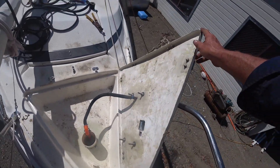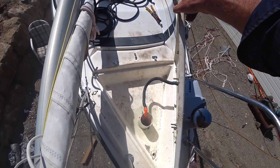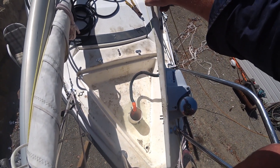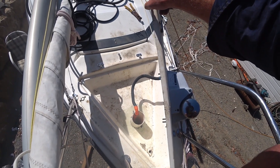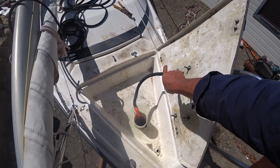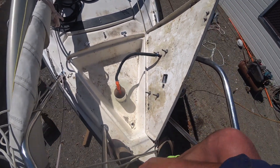And so when I close this one up, you can see there'll be a bow down. So any water that gets in there — like say when we're travelling along — with the bow in the cable there, it'll hit down. The water will go to the bottom of the loop and drip down and run out our drain hole with any luck.